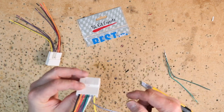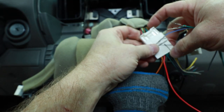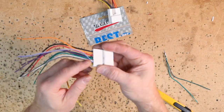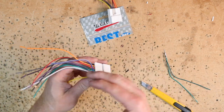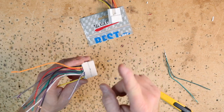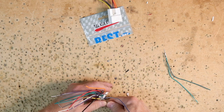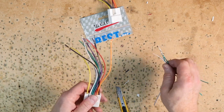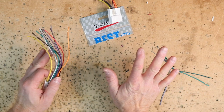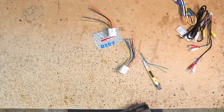I'm going to plug this into the car real quick and check. Simply plug this in, look at the pin location, and check the other side. If there's a wire there, obviously you're going to need to keep it, but in our case there wasn't. I can remove this and use it — cut a slight slit, slide it right out. Now we have the three wires we're going to need for our steering wheel controls. I haven't showed you them yet, so don't feel like you've missed something — let's figure out what those are going to be.